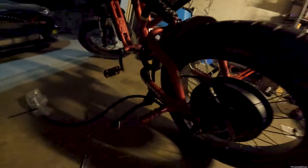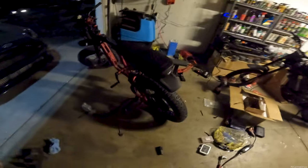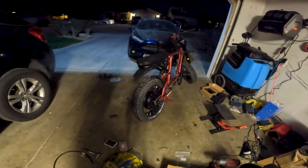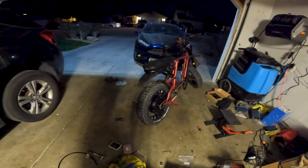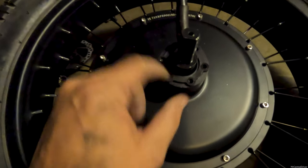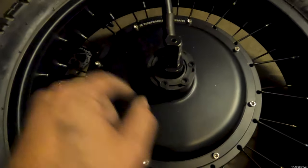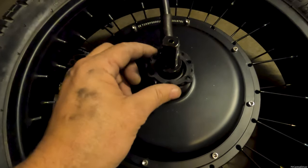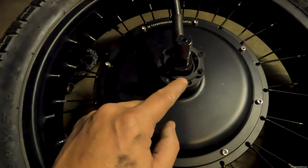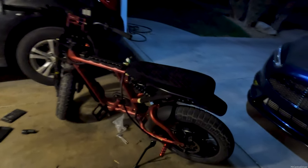The good thing is we got the bike together, but it's not going to be moving for a while. I need to take it all apart again and remove that spacer for the brake. Just in case you guys get this kit — you want to take that spacer off. This washer sitting behind the rotor, if you remove it, it's going to give you more thread into the hub and that clearance from the rotor bolts. I'll update you in the video if removing it causes a problem.